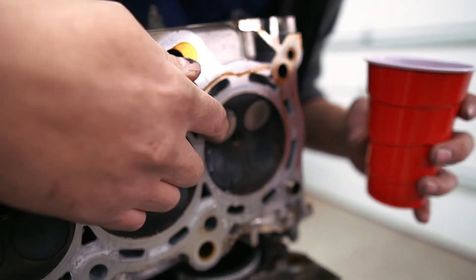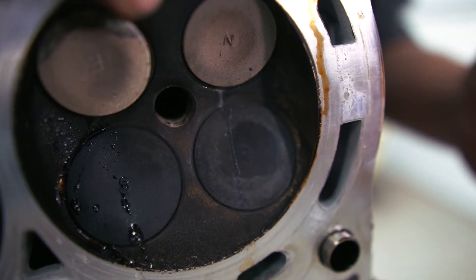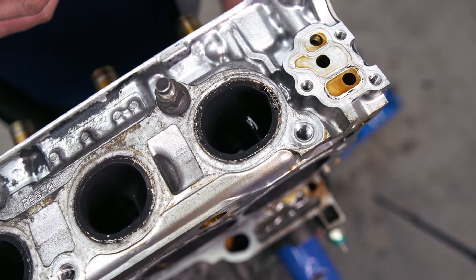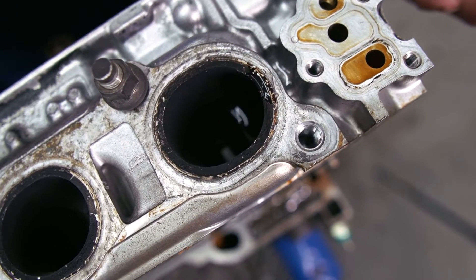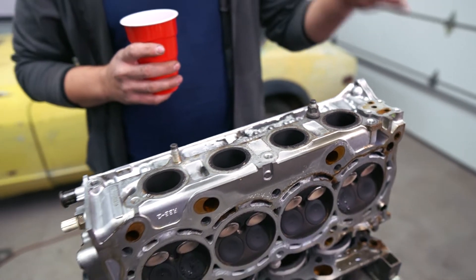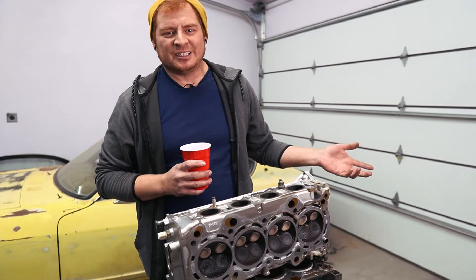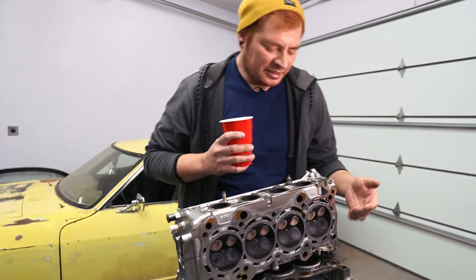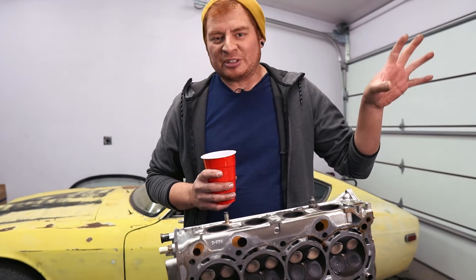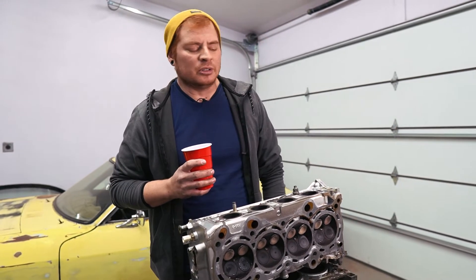Right here, the valve on your left is still bent, but the valve on your right I replaced with a good one. There's water in here right now and it's not leaking out — we're holding the entire amount of liquid in that chamber without any leaking out the front. That tells us the valve seat is still good and that valve is good.